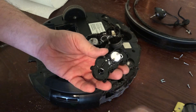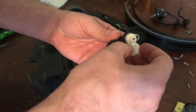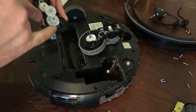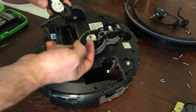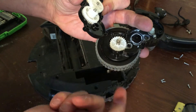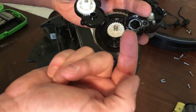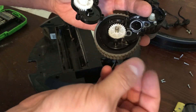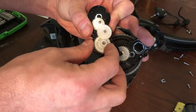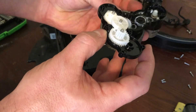I'll show you the way these go back together because I have had them pop off like this before. What I found with these is through the wheel you'll actually get gunk up in there. There is a seal under this gear where the shaft of the wheel connects, and you'll get gunk that gets through that — a little bit of fine dirt will get through and impinge the gears. Usually just taking this apart, cleaning it out a little bit, and re-greasing it is enough to make it work again. So not that big a deal.